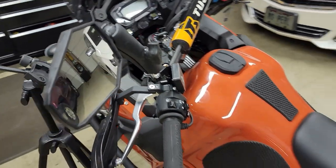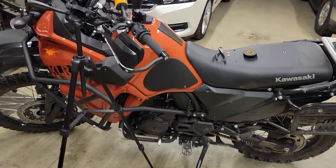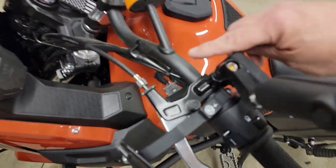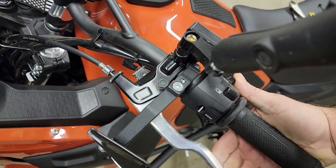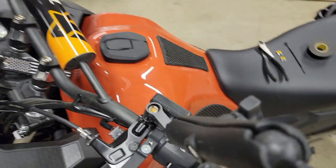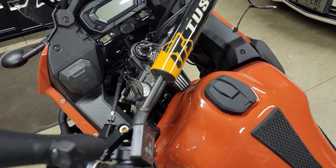Now, there are plug and play bypass things you can buy through 3D Cycle Parts. He has those on his website. I will include a link in the description here, but really all you're doing is bypassing the switch to let the ECU know that the clutch is pulled in, basically tricking it into thinking the clutch is being pulled in all the time.